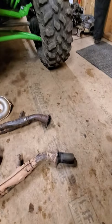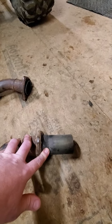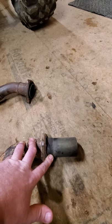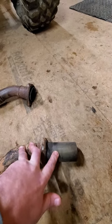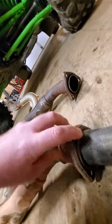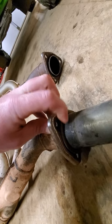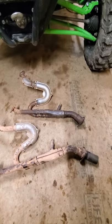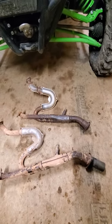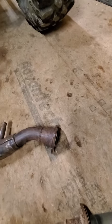As far as taking the rear cat off, a lot of people are just drilling them out, which if you want to spend the time to do it, knock yourself out — but it's a waste of time. This doesn't support the muffler at all. The muffler bolts into the three holes on that flange. When you do this, there's a little gasket there — make sure that stays. Usually it'll stick, but a lot of people forget it and then get a bunch of decel popping and backfiring and blame the cats. It's not the cats — you left that gasket off. Just remove the muffler — there are three bolts. Take them off, take a sawzall, chop it off, you're done.